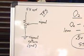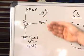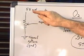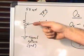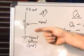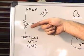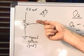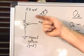Let's go over to the chalkboard and evaluate the readings we got. The throttle position sensor, which is a three-wire sensor, is what is called a potentiometer. One wire is going to 5 volts — the reference voltage. One is going to ground — signal return. And the signal wire is actually a wiper that's going across a resistor. At closed throttle we had 1 volt, meaning the wiper is closer to the ground side. As I move the throttle blade to wide open throttle, I got 4.5 volts, so the wiper went closer to the 5 volt side.